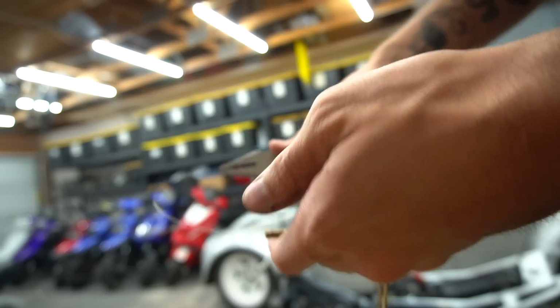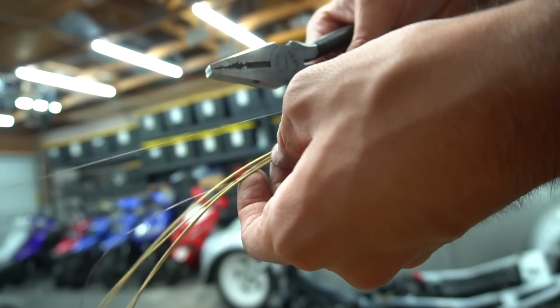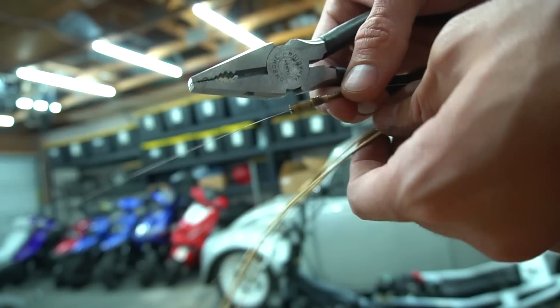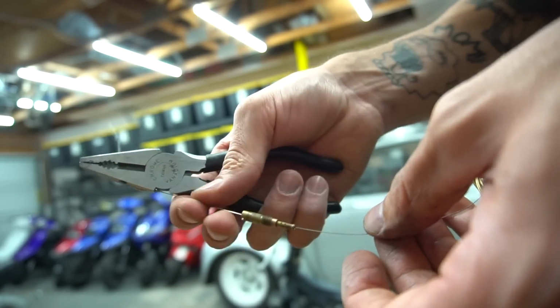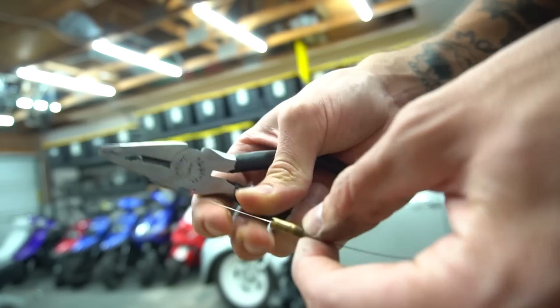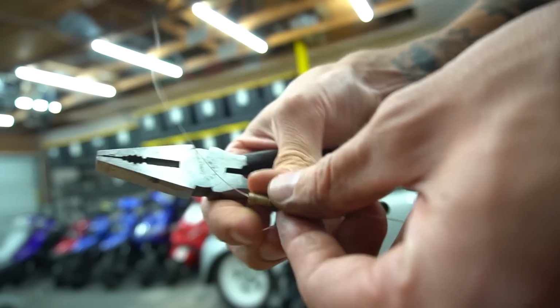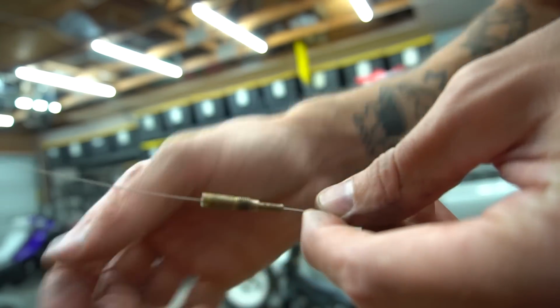My favorite thing ever to use right here to clean jets. It's a set of guitar strings, so they're different thicknesses, and some are rough. So we could really get inside to clean these jets. Took the smallest string. Finally broke loose the pilot jet on here. This pilot jet was so clogged. I took an air compressor to it. I took carb cleaner. I've been sitting here picking at it using wire.